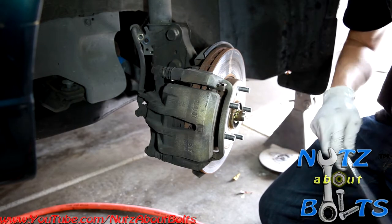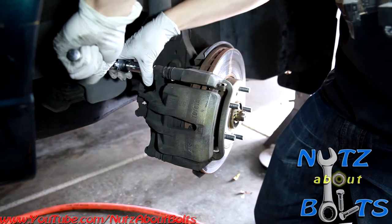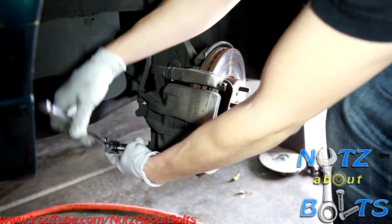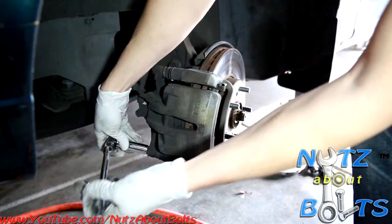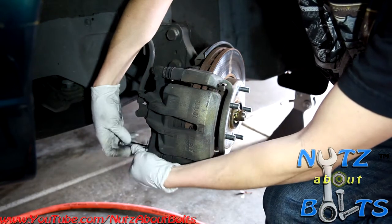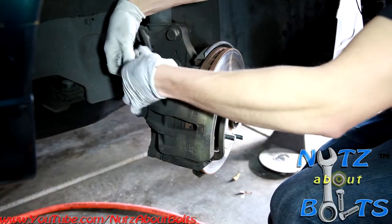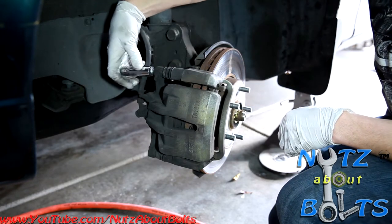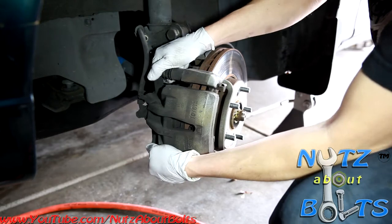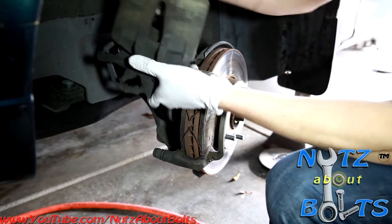And then I'm going to use the 14 millimeter socket to get the caliper bolts out. There we go. Slide the caliper back out. It's sticking a little on the pads, but there we go. Alright, so I'm just going to hang this up out of the way